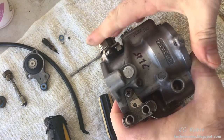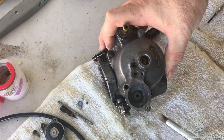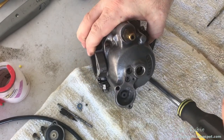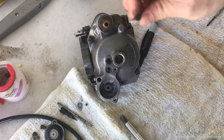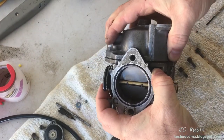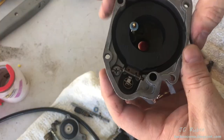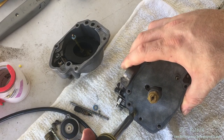This bike has had it rough with its problems as of late. The hole's not plugged though — we can see straight through there — dirty but not blocked. Going to unscrew the bowl next using the screws on the bottom. The fourth screw is also used for the accelerator pump, already removed. Once we can feel the seal broken we're going to lift straight up and out. I can see the gasket is still on there — we'll put this off to the side.